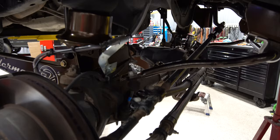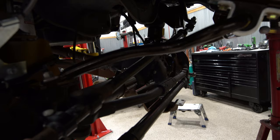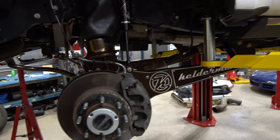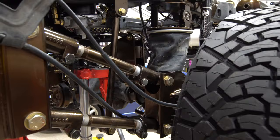It is the next morning. I ended up staying a little bit late and pretty much getting everything finished. We got our front brake lines on, and then zip-tied the ABS lines together. Got our sway bar on, we got our drag link on, track bar is still down — we're going to get that put on on the ground. We got our front sensor linkage hooked up, we also drilled and tapped into the radius arm for our sensor, got our front drive shaft on. So pretty much the front is complete, just besides this track bar, and then obviously we're going to have to align it — we're not going to do that until we calibrate the truck.